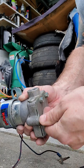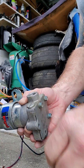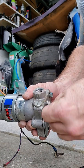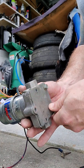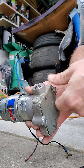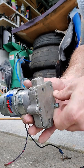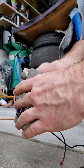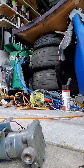It might be time to step it up and go fuel injection, because you know I got it like that. I'm just kidding. I wouldn't be able to afford to do that. All I'm going to do is clean it up, take it apart carefully, because I've never taken one of these fuel pumps apart, and then I will clean it up with some chlorinated carbon choke cleaner, and then I'm going to put my 8AN lines on it, because it had a 6, actually it didn't have 6AN, it had old school locks on it. Alright, I gotta get a screwdriver, so I'll be right back.